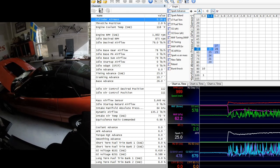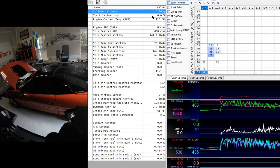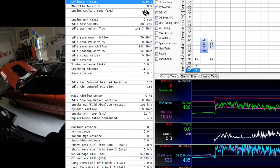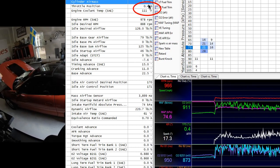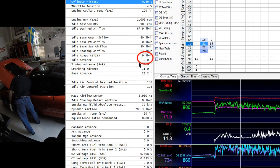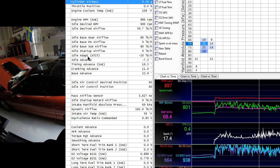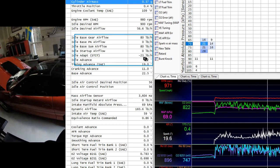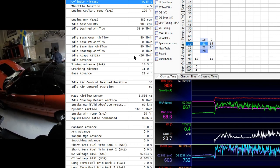Spoiler alert — it actually is good news. Right after fixing the throttle position sensor, where I could get the throttle blade and the sensor to register zero, I didn't do any tuning and we have this data log. It's showing zero. We run it to where it cranks — no foot on the throttle. The air coming in sucks the blade open to 0.4%. What is important to note is that the idle tables are being referenced. There's adapting and idle spark advance trying to keep idle steady. The short-term idle trims are right there working.